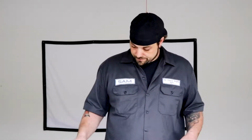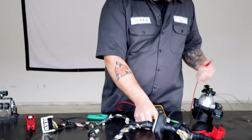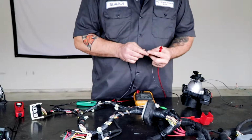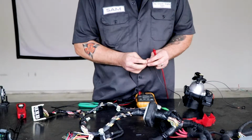And when you begin electrical diagnosis, right, you've scanned it or you have a system that's acting up or not working, any of those things, I guess probably for what I'm going to show you today, we'll go with not working or barely working. So first thing that we always do is grab our meter, right? We're going to get the leads here, and you would just isolate your circuit just like anything else, and then you're going to test the ohms, okay? So let's do that.